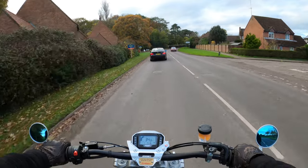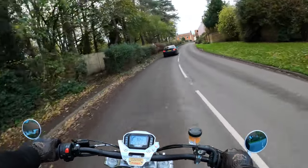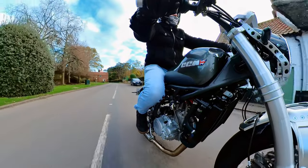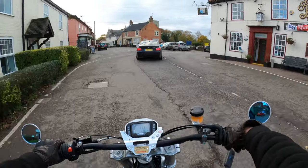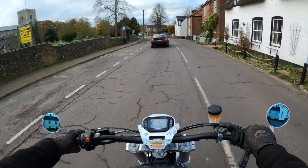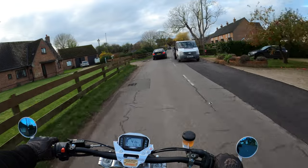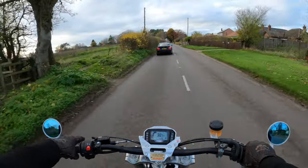I have just had a service done. Obviously you have the option of taking the bike up to Bolton, which for me isn't really feasible. So I actually had one of the mobile technicians come to the house and he did a great job — he did the service on the bike. It's not a massive service on the first one, so he drained the oil and he actually replaced the clutch slave cylinder. Little problem I had — nothing major — but he had one in the van, so he swapped the slave cylinder over and the clutch is lovely now. It's a hydraulic clutch.